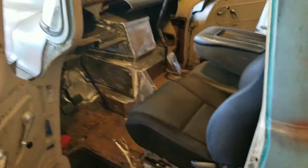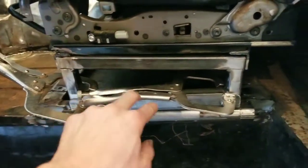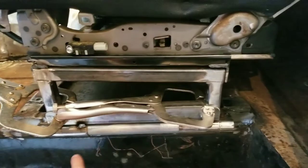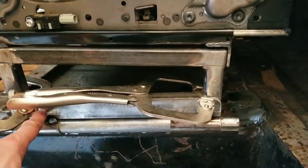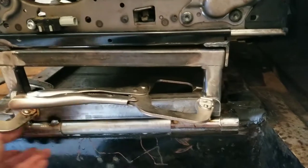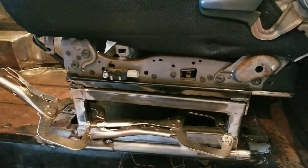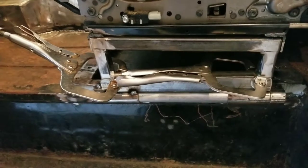I couldn't resist trying it before I filmed it — sometimes I even surprise myself with a good idea. This sucker worked out beautifully. What I did temporarily is take some vice grip clamps and clamped the one-inch seat frame to my track, which is in turn welded to my barrel hinge. I'm going to run three-inch bolts through this side, probably two or three of them, bolting the track to the seat frame. The barrel hinge with the frame will always be attached to the truck. On the passenger side, I'm going to run three Quick Pins, which will allow me to pull the pins and pivot the seat when I have to service the battery.